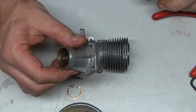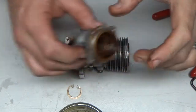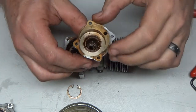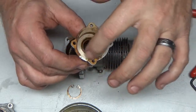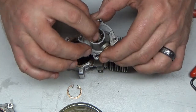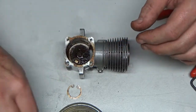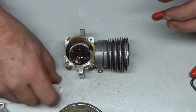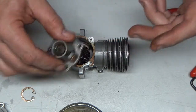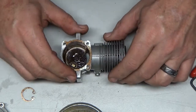I've got the crankshaft out of the front housing and as you can see, it's pretty nasty. I've got this off the back timing gear. There's a bearing here — I've never replaced one of these so I have no idea how hard it's going to be to get out. And then there's another bearing here. Before I attempt to remove any of these bearings, they're going to have to go through my ultrasonic cleaner to get the grit and crap out so I can oil them and heat them up to facilitate removal.